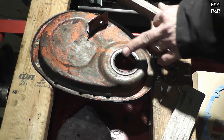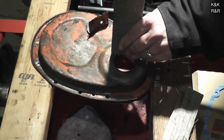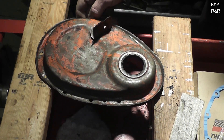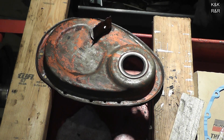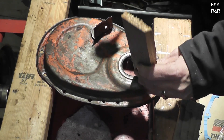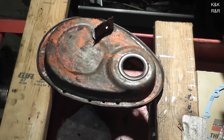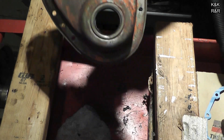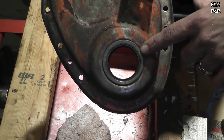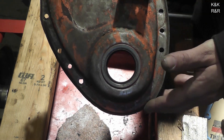As you can see, it is flat and we have a little bit of RTV coming up. Just make sure it's flat — if not, just take the edge and smash it down. Nice and flat, done in less than five minutes. Pre-lube this with some moly. We'll do that when we install the harmonic balancer, but for now this cover's ready to go.